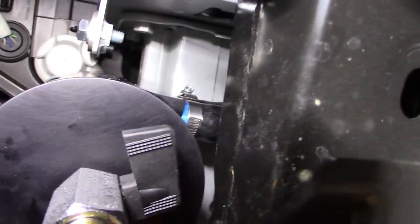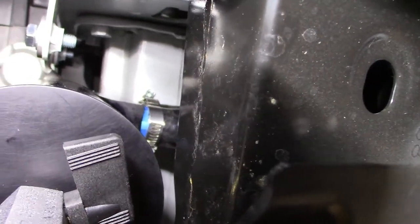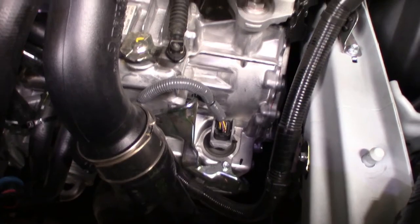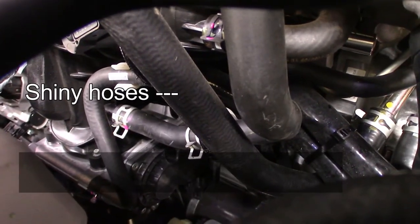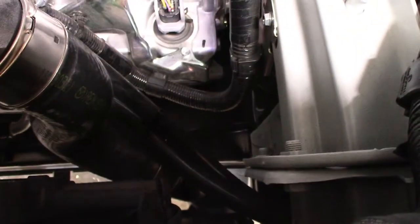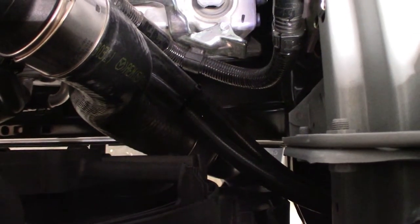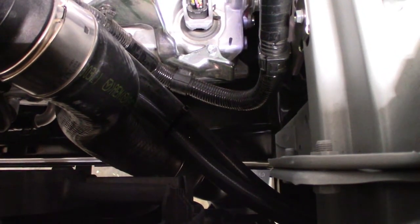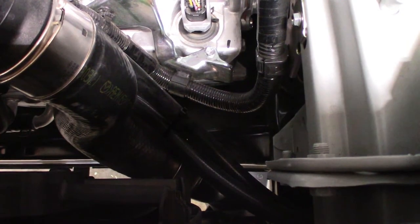The lower here really wasn't all that bad. You should be able to see the hose clamps there. On the Mazda 3 that I did, I did not put hose clamps on, and what happened was that when it got cold, sometimes I could smell oil. So on those two, I have the original spring clamps that were on that little elbow, and then down at the bottom I have the worm gear clamps that the kit came with. I'll have to check it, maybe in the next thousand miles, and see what happens.